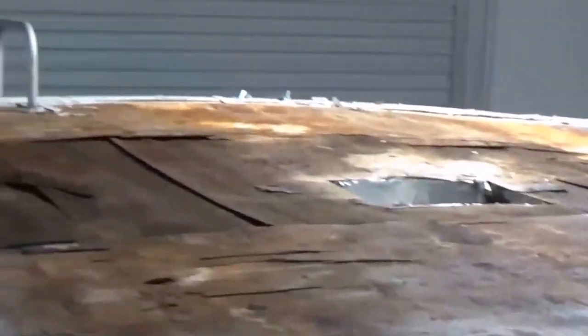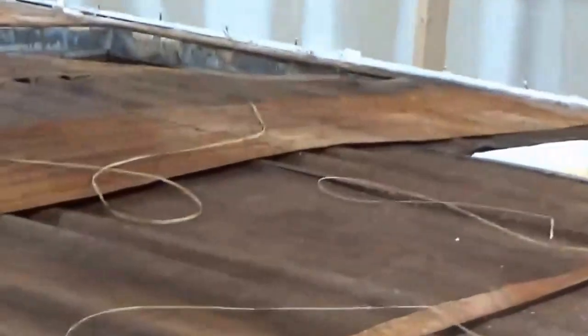So this is all the damage. We had to peel the fiberglass up, and this is all damaged because there's no curbs on it. We're going to have to redeck this entire coach. So the deal is we're going to take all this loose stuff up. We got to dry it out. We're going to have to sit blowers on it and dry it out really well before we can do anything with it. Then, where's the lens to this shower? Here, it's over down this side. You can see some of this right here, how bad all that rot is.